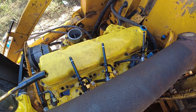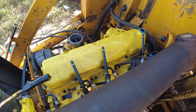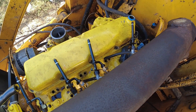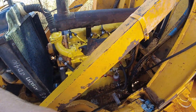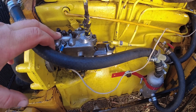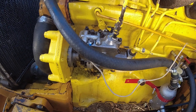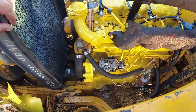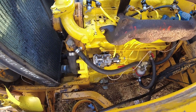It seems to have fixed itself. As you can see in the slow motion video, it is putting out a lot of fuel and it looks like it's spraying good — not all plugged up. These are brand new injectors I bought last year right before the engine went out. So I want to go ahead and get the injection pump pulled off and retime it — just rotate 180 degrees and see what that does.